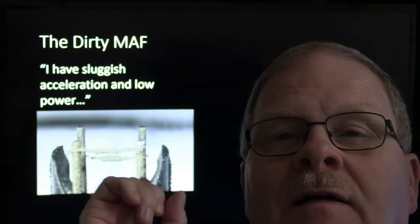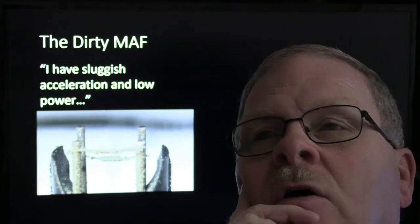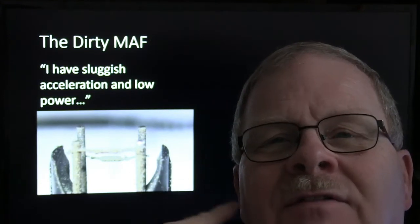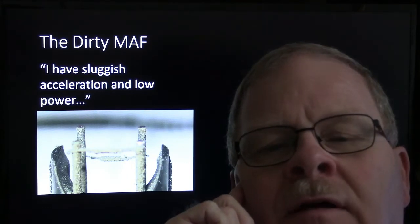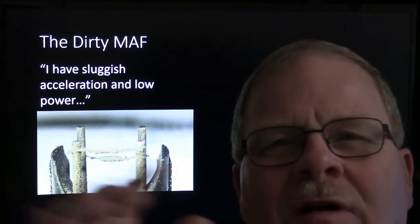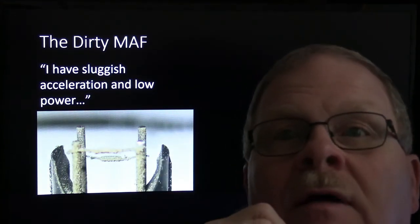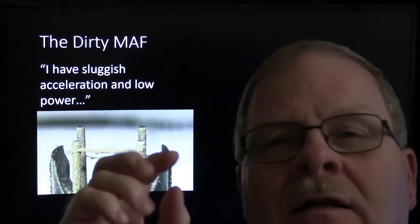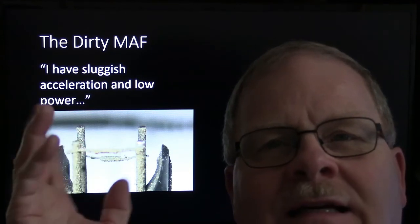Anyway, long and short of it is, these right here are worse to get this way if somebody is using second-rate air filters or if they have air filters that have holes in them and it's letting dirt go through here and it's getting cooked under that hot wire. They make some stuff; a lot of people know about cleaning these things off. I worked on a Crown Victoria one time that came in for a different problem and it was under warranty. And I didn't like the way that it accelerated. Those Crown Vics, my dad drives a Grand Marquis with that 4.6 in it, that thing will run right out from under you. I mean, it's really got some power. But that one didn't feel right. And I looked with a light down in there, and it looked to me like that little hot wire plastic had melted that platinum wire into that plastic, and it wasn't able to do its job.